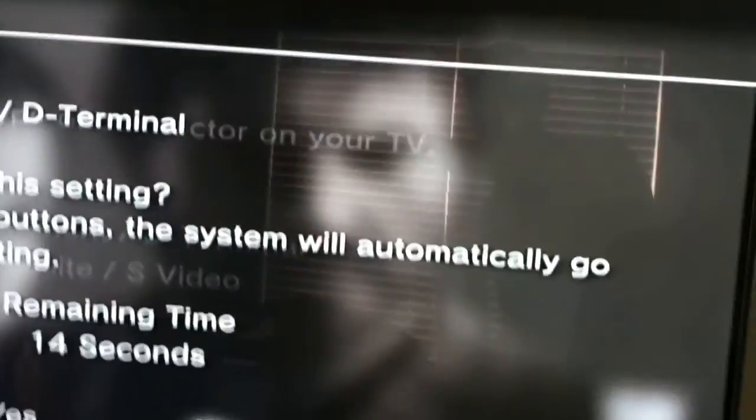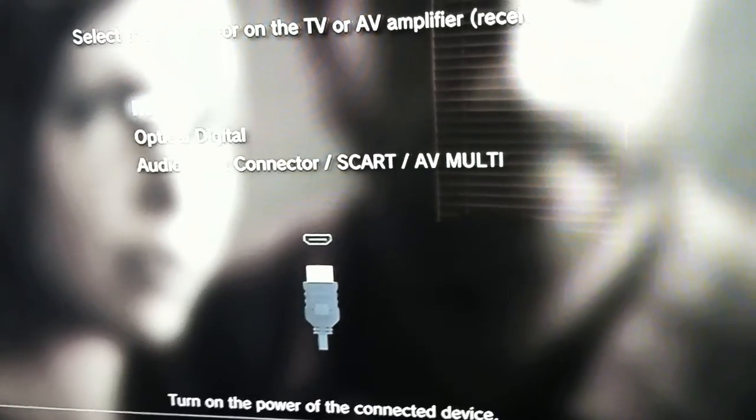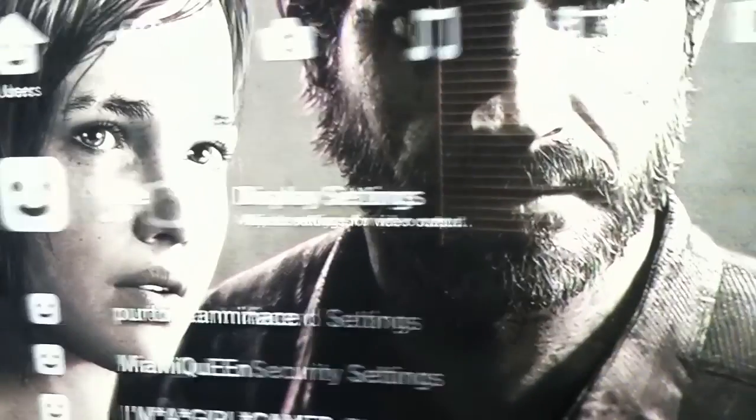Don't unplug the component cables — just unplug the HDMI and plug it straight into the out port of the HD PVR. You should get a picture on your screen. Click yes. I'm on a PS3 so I'll click 720p — you could do 1080p if you have an Xbox. Now we've got it on the laptop screen. Click yes, and then set your audio to the last option. Now you've got your audio and video all coming through the HD PVR device.